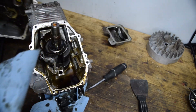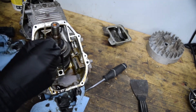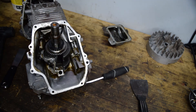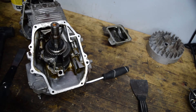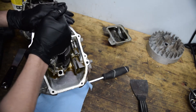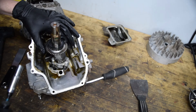Easy enough, but it's going to take a while to clean up. They used so much RTV — there are just globs of it. I'm legitimately surprised this stuff didn't break free and float around in the engine. That's part of the risk with pressure washers: people use them once or twice a year at most and go by use, not age. Chances are this thing had only one or two oil changes in its life, which is not great. I'll probably still order a timing belt and crank seals since I'm already here.